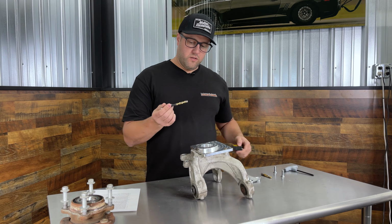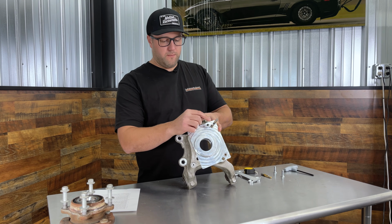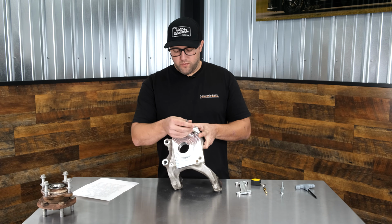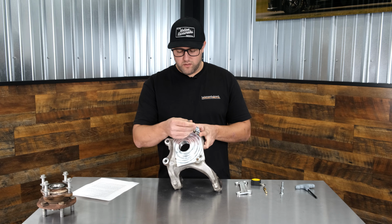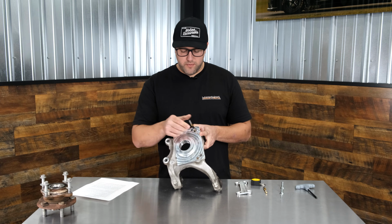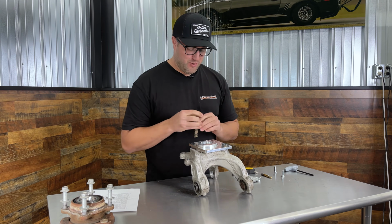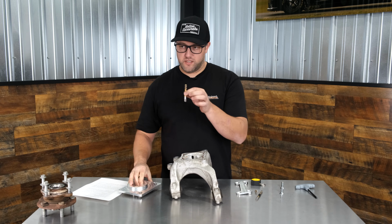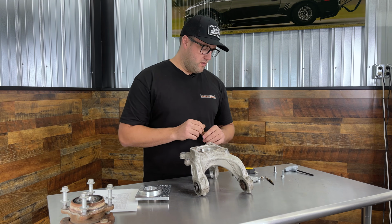So we're going to take our drill, 5/16, drill in number 2 until the tape reaches the top of the fixture. And once we make sure we do that, use oil and stuff, and take your time because you really only got one shot. So drill this hole as deep as the tape, and then we're going to remove the drill bit, remove our bolt, and then you're going to take your 3/8-16 tap and thread the hole as far as you can go.